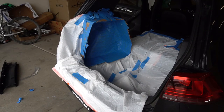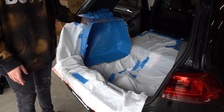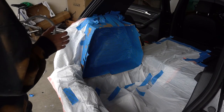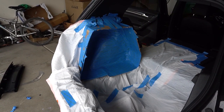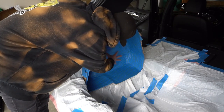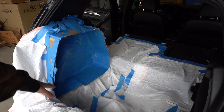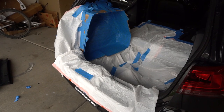Here's what we have going in the back of the GTI. We've laid out a bunch of trash bags, and here we have our templates all built out — this is basically the inner shell of where we're going to be laying the fiberglass. Everything in here has been laid with blue masking tape, which is going to protect everything from the fiberglass. The fiberglass only sticks to the blue tape, which you can just peel off once the fiberglass has hardened and you pull the box out. Cover everything you don't want fiberglass resin on — that's why this looks like a ghost town back here.